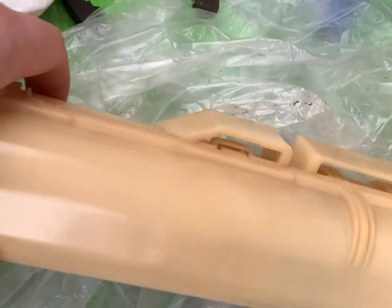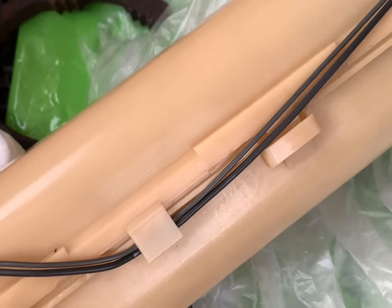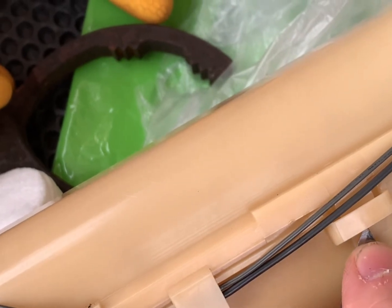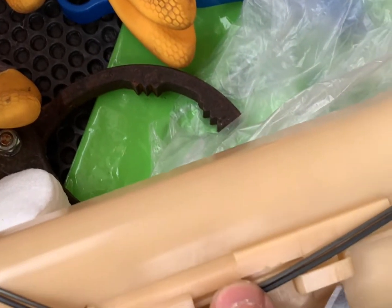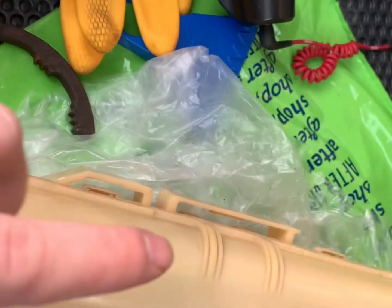That's back assembled. The tip for getting these clips off — as you can see we had a few casualties ourselves — is to very carefully use a knife, go to the side of the clip, slide the knife under carefully not to break the clip, so you've got that bit lifted, and then if you've got another person it's easier — get a flathead screwdriver and twist to pry open the clips. There are clips running on both sides, so you've got them that side, along here, and one in there as well. That bit's back on.